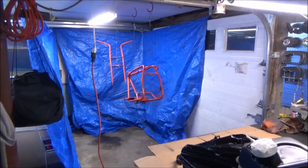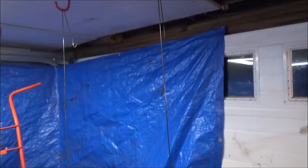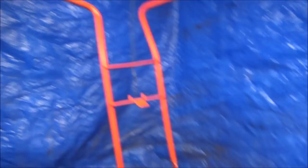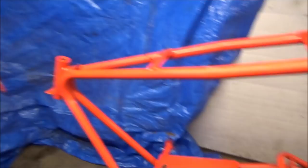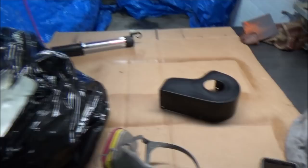Alright, got the temporary spray booth set up with temporary lighting, just hung up with coat hangers. Got the fork over here, frame over here - scuffed up pretty good, didn't take it down to metal but I'm respraying the same color so it should be fine. Also going to hit the motor a little bit - the gas tank got some overspray so I scuffed up the top. There's a bubble there I'm not going to mess with. Will re-hit the top and the belt guard and that'll pretty much do it for painting.